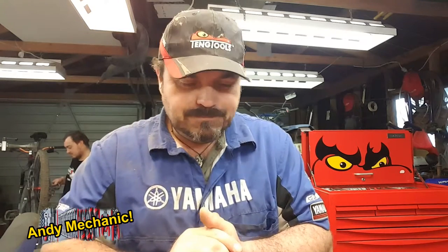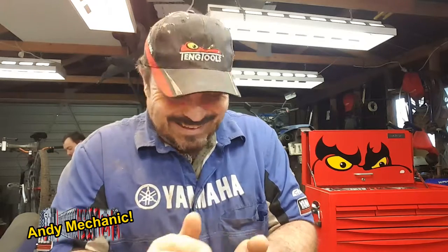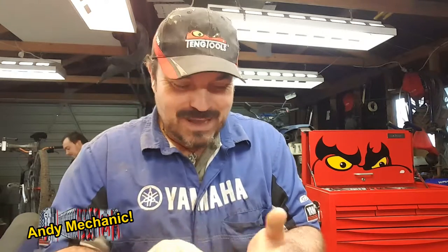So yes, the engine is currently in bits, hence all the black wrap around the engine. It's been in bits for how long, Benjamin? Well, no, because I did the rear wheel a year ago, so it must have been in bits for a good 9 months. Absolute sacrilege. And what happened was one of the pistons clipped one of the power valves, and that shouldn't happen in one of those bikes, and it caused the back wheel to lock up. And then what happened, Benjamin? Threw me into a ditch. He fell off on the driveway at home at the old house at Puhoi. But no, he didn't hurt himself, but it didn't do the bike any good.